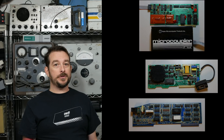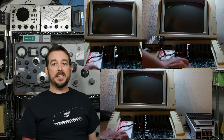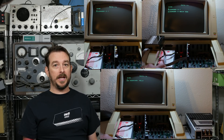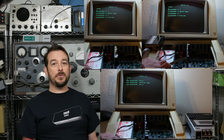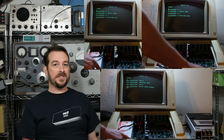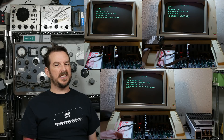At this point, all three of the modems that I've shown you have very similar manual firmware interfaces. That is to say, if you activate the card — such as IN-2 — and press Ctrl-A to get the modem's attention, it gives you a one-liner prompt for you to press another character. Both the Micromodems say the same thing, and the SSM says things a little bit differently.